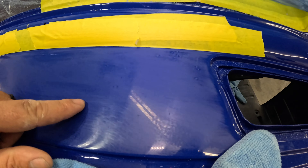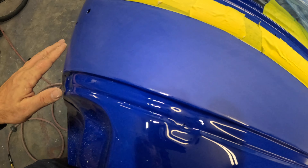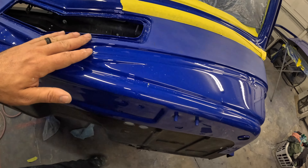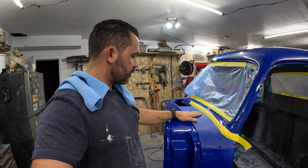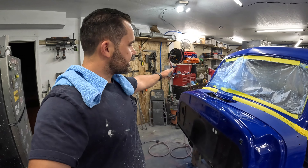I did a light scuffing just to show how bad it really was — all the little dirt nibs. Now it's all sanded up and it came out pretty good. I figured it would, except I definitely got something buried in the clear there, which kind of sucks. Over here there's a little white spot that seems more towards the surface. I'm going to go through the grits and see if that comes out. This other one you can tell is pretty buried in there. I've already jumped over and done the other side, which sanded out really well. This side has two little dots buried in it. There's not much I can do about it — instead of trying to sand it all out and re-clear it, I'm going to buff it out and see how it turns out. As long as it looks good overall I'll be happy.